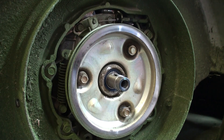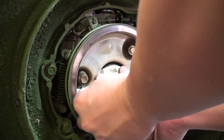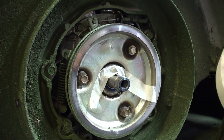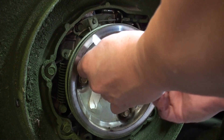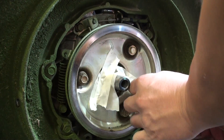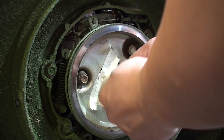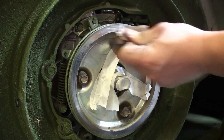Now we're going to repeat the same thing for the flywheel brake. Before proceeding, I'm going to put some masking tape to cover the bearing and woodruff key areas so that no metallic particles get into the bearing assemblies. I intend to have this mower last several more lifetimes, so I'm shielding it off to prevent metallic particles from falling into the bearing area and also taping the end so metal doesn't go into the drive shaft or blade mount. Then use sandpaper to remove that mirror finish.